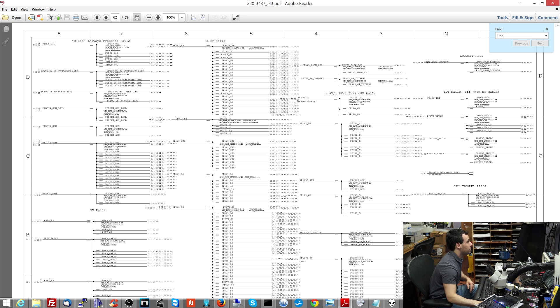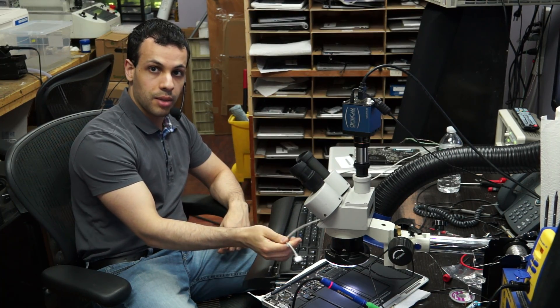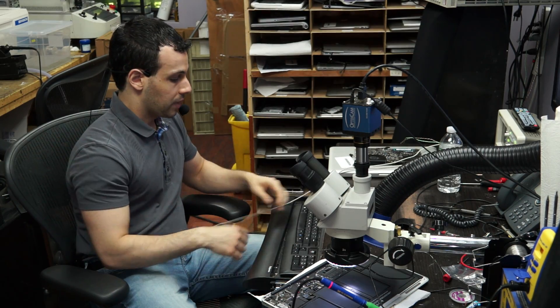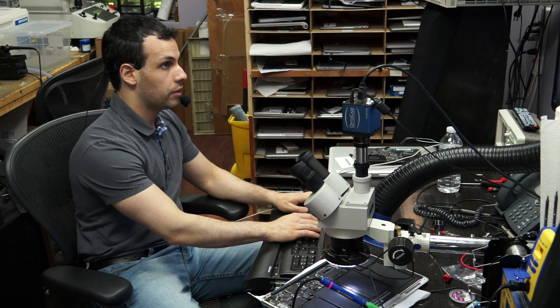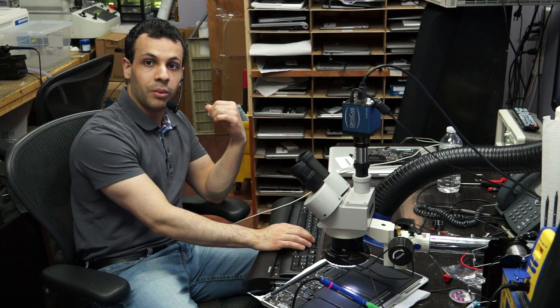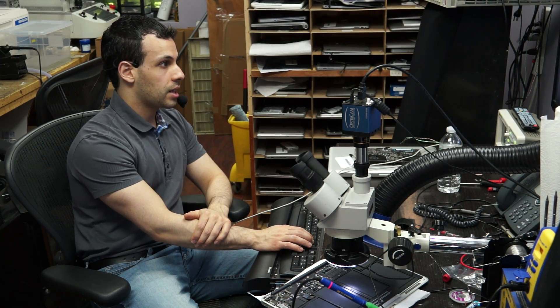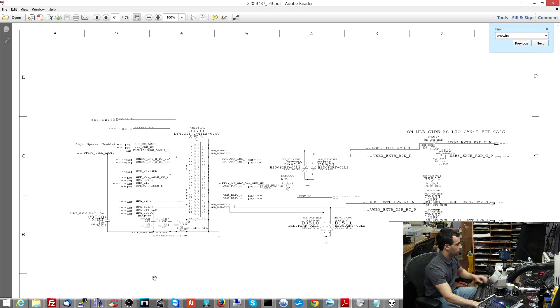Airs are just bleh. So PP_Bus_G3Hot over here is supposed to be 8.6 volts. I measure it and I get half a volt. One of the things I've talked about in many other videos is the one-wire circuit. In order for this to turn green, in order for it to actually communicate with the computer's SMC, and for the SMC to communicate with the charger so the charger can turn itself on, you need the one-wire circuit to be working. The one-wire circuit works off the PP3V42 power rail. I checked the PP3V42 circuit on here and it's zero volts. I looked around the 3.42V power area and noticed there was one resistor that didn't look the way it should.